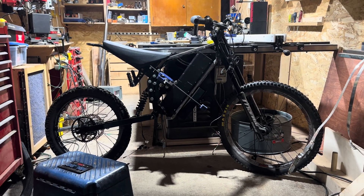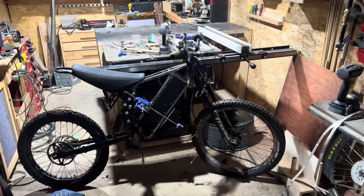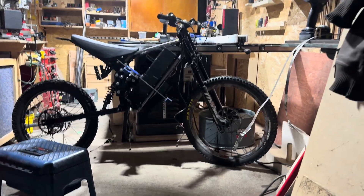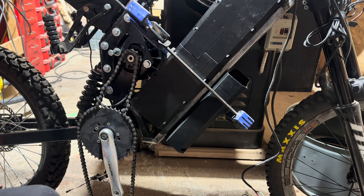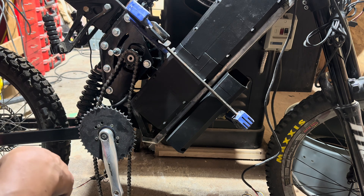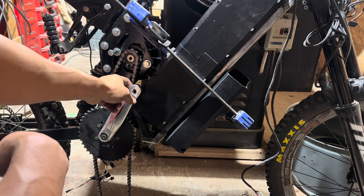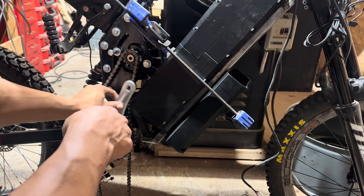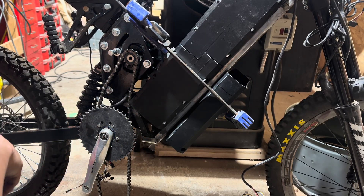I think the geometry is a little weird on this thing, but it's kind of this weird cross between a bike and a dirt bike — kind of like between a Surron and an e-bike undercover. I've taken this opportunity to get the chain on, get this sprocket on, which is nice — see it all moving and find out all the things I didn't think about. So one, there's obviously a clearance issue here when this pedal goes by this battery box. I have to offset a little bit that way, but it's not too bad — I can actually get by.